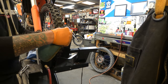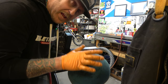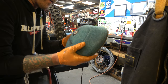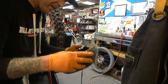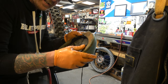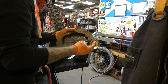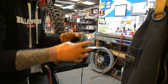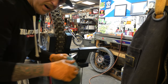Let's pull the spark plug out and take a look. The spark plug doesn't look too bad — not oil fouled. I'm starting to have a little hope that this motor might be okay and just needs a little bit of love. That would be really cool. It is a bummer that they're not taking care of their air filters, but if we caught it early, we might be okay. That's what a clean air filter should look like. The bike seems to be good. I had to clean the pilot jet out — it's been sitting all winter — but other than that, I think we're good to go. I think they dodged a bullet. I checked the valves and they were in spec. They said it was smoking, but I don't see any smoke coming out of anywhere. They need to pay attention to the oil level and their air filter maintenance.